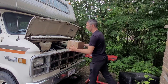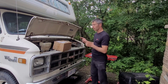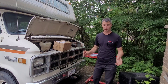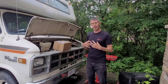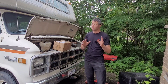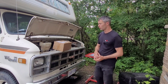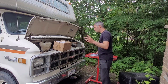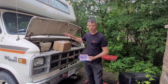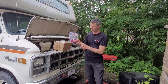What Suzy currently has — which I don't think is original — is a four-barrel Quadrajet carburetor, also known as a 'QuadraJunk' all over the internet. A lot of people don't like that carburetor. I happen to think it's not bad for the application, but if you're trying to hot rod something, there's a lot more work to be done. The Quadrajet is a spread bore versus what I just purchased, which is a square bore, so I had to get an adapter plate.